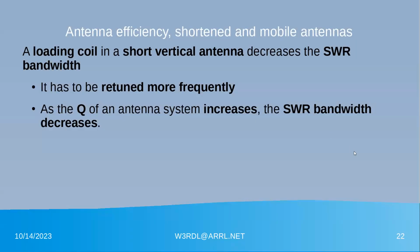Yeah, you see the 11-meter guys take that serious. Well, the problem with the loading coil stacked like that is the weight of the coil, right, and your stability. That's one of the trade-offs. So that's why you still see them keep the base. At 60 miles an hour, how does it affect the base? That comes up with capacitance hats too. Well, because the optimum one is more wind resistance. Exactly. That's also why they have a pickup, to get that big loading coil behind the cab.